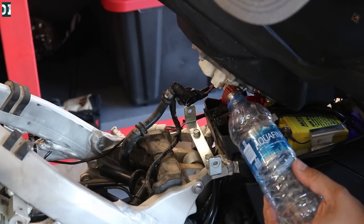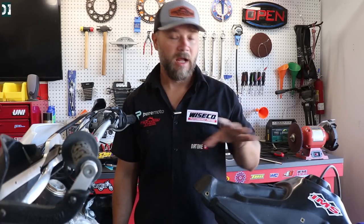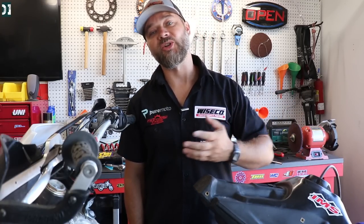That doesn't look like 45 PSI. I think the fuel pressure is our problem here. The pump does make a noise and fuel is coming out, but I was just gently holding my finger on it and it was not really pushing any pressure. If you really put your finger on that hole and turn the pump on, it should build all the way up to 45 PSI. If it doesn't, there is definitely something wrong with your pump.